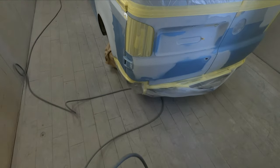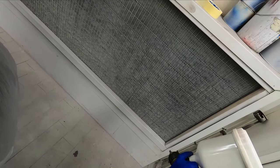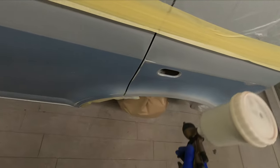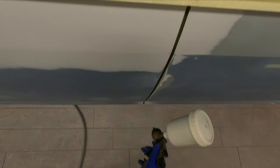So wet on wet primer time, and I'm just going to be using my standard high build mixed four to one. My personal way of doing it is I add about 30% thinners, which gives it a real nice flat even flow out on the van. We can just use a very small amount just to get coverage to seal up any of the tiny little bare metal rub-throughs, any little bits of fine filler. The way I'll do this is I'll set my gun as if I was painting top coat because you want this to be nice and flat, but I'll only be using a tiny little bit of fluid and normally I'll turn the fan down around about halfway, giving a very small fan.